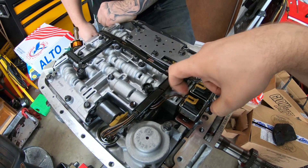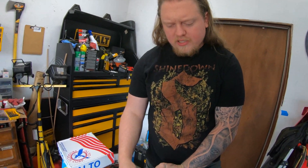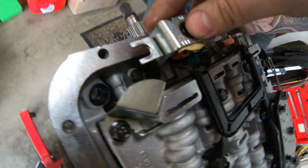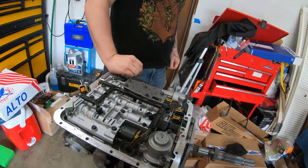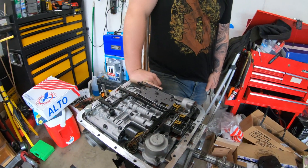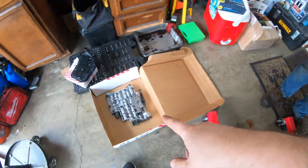Looks like there are some clips we need to take these solenoids out with — hopefully not lose them again. We still need to get a replacement clip for this guy. The solenoid's actually on the table. That's the other one that goes here that we need to get a clip for. We're going to go ahead and start tearing it down. We're not necessarily going to be showing every step — this isn't like a how-to necessarily, but you can probably follow along and figure it out. Just showing you guys us trying to band-aid fix this 4L60E. So we took the valve body — the top part off here.